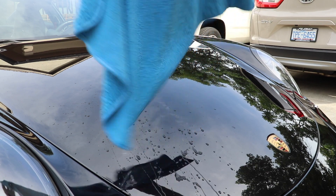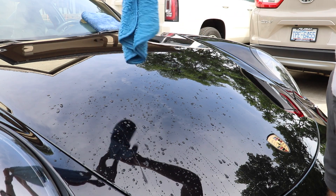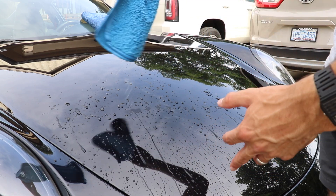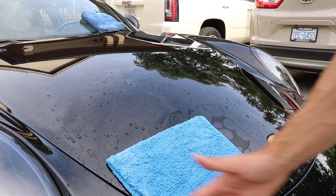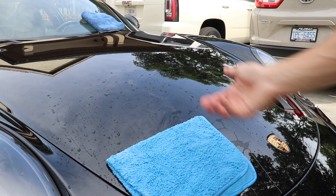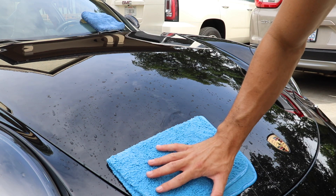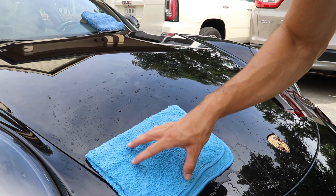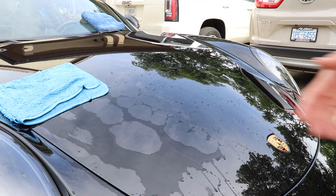I'm using this ultra plush microfiber towel — I'll link it in the description box below. It's dripping wet and I'm going to fold it into fourths. You can see there's some sort of coating on this paint already — the water's beading off very easily. I'm starting at the bottom, using the character lines of the car to tell me where to wash and dry first, separating the hood based on where it's literally separated. This is a sort of Gary Dean method — I'm just letting the pressure and weight of the towel do the work, not putting any pressure down, just dragging it across the paint to take surface dirt off.